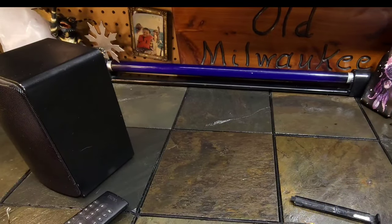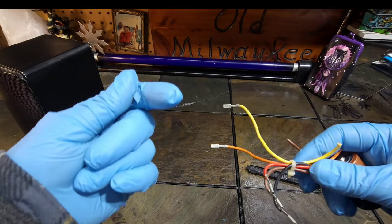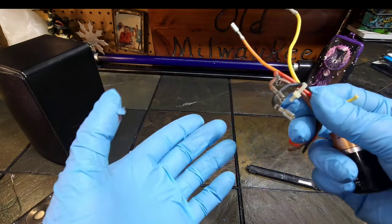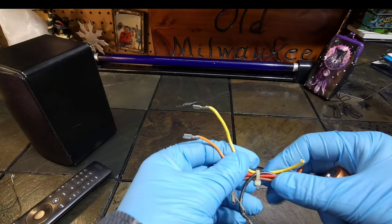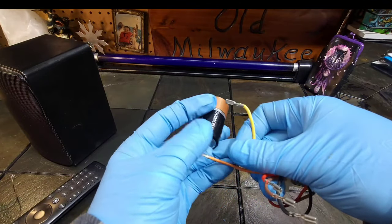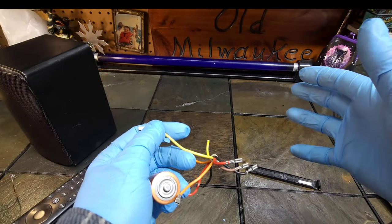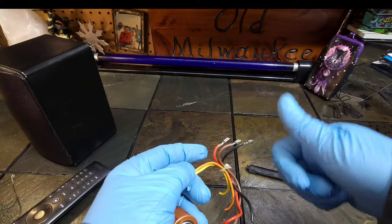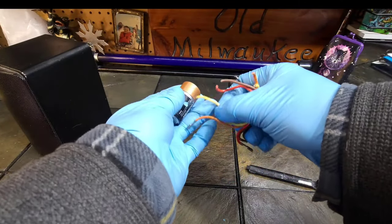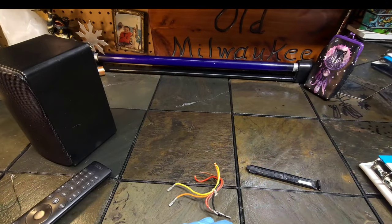One last tip for people who may have speakers already installed in their car: if you're doing an aftermarket install, or if you can get to your speakers in your dash where they connect to your amplifier, you can do this as well. If you know what your two speaker wires are but just don't know the polarity, connect the positive and negative and have a friend check the speaker to see if it goes up or down. Another trick is to put your phone up recording, do the connection, then go back and check the footage. Hope that helped you out, guys.